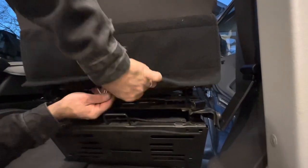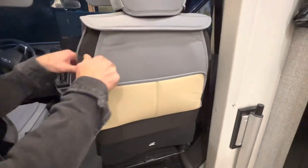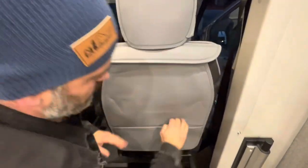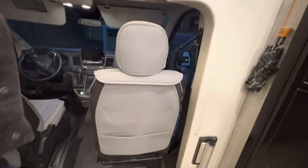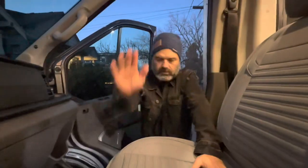We're just about there. We've got this nice and tight, things are looking good. We prefer this method. We're going to drop our flap — we've got some nice pocket area there. I'm going to step back outside the vehicle, swing around to the front, double-checking that I like the way this is fitting around the seat. Our straps — we just want to make sure — go between here, not over the top. I cannot stress that enough. Right between, hooks in, right between, hooks in. You'll know you did it right because the seat adjuster is free with no restriction.